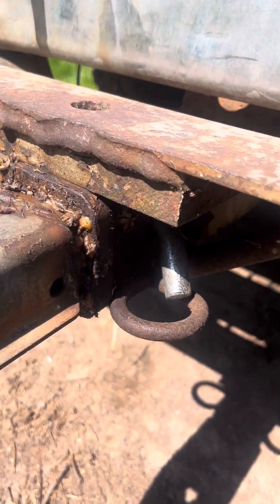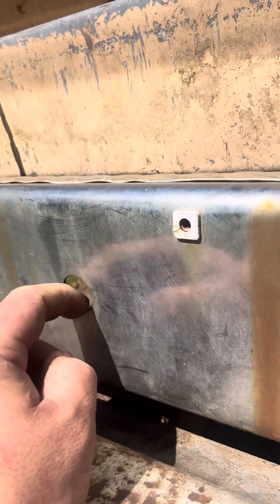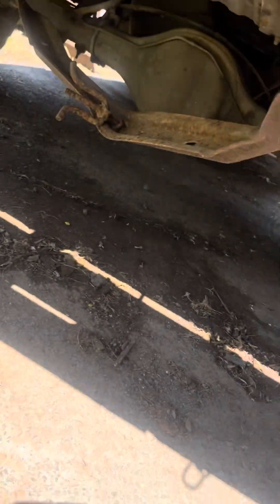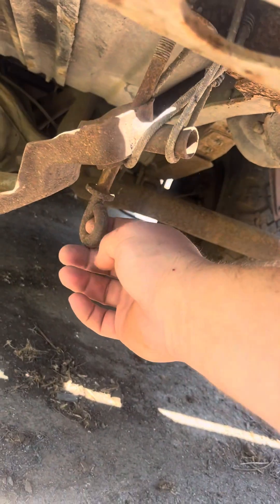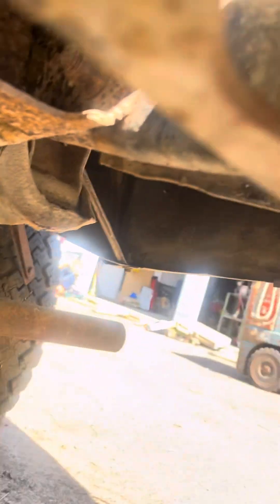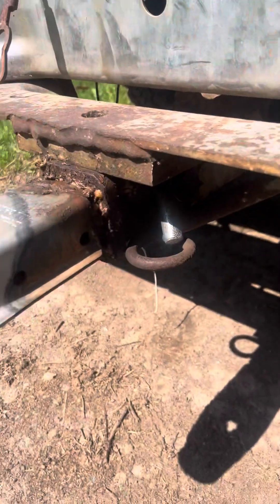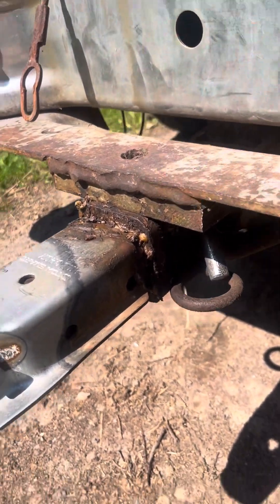You want to go somewhere else. On this truck, these old trucks have solid steel bumpers — that's a really solid point you could put a hook in. Or if you look back underneath, we've got a spare tire mount that's pretty solid, and we've got some holes in the frame we could go to. Those would all be good spots to clip the breakaway switch to.